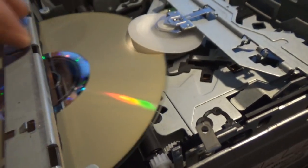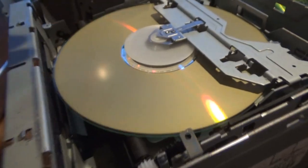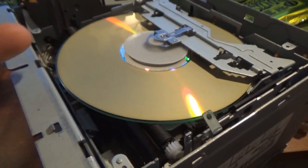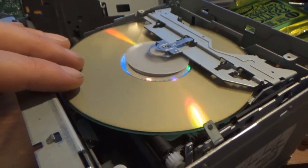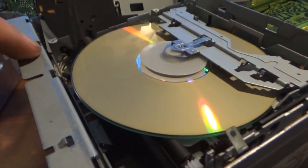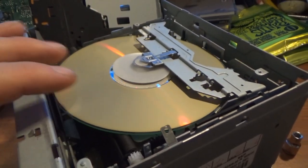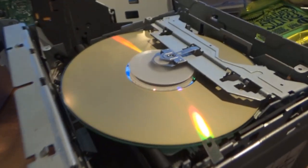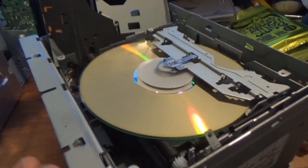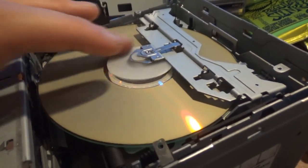So over time, when you have the CD in here and the CD is spinning round and around, and this thing is spinning and the bottom is spinning, over time somehow the CD, multiple different CDs, will lose traction, and as the eye is trying to read the CD, this is just not really spinning the speed that it should. The CD doesn't spin as fast as it should, or a bump will make it skip because there's nothing keeping these CDs from free spinning.